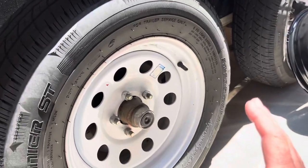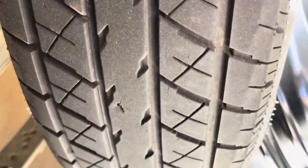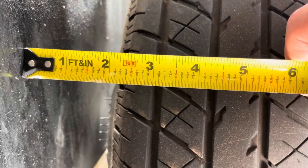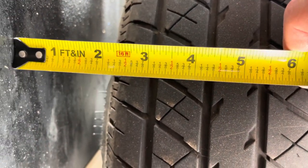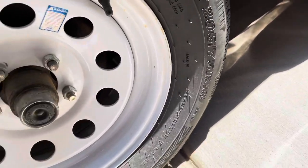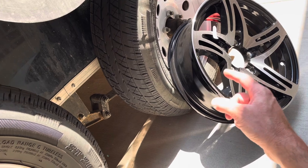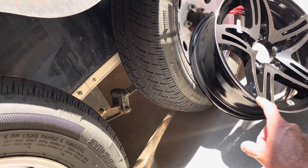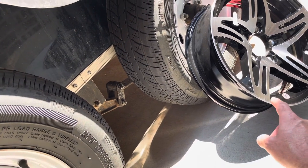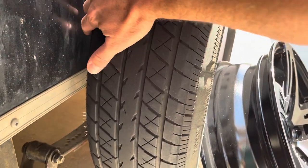These white steel wheels that come on this trailer are a five-lug pattern, five inches wide. From the inside, there's less than two inches of clearance to the side of the trailer. A lot of aftermarket aluminum wheels you can get for your trailer are six inches wide. This was probably the only one I found that was five inches wide, and the reason I went with it is just because of the clearance — I didn't want this poking out any closer to the trailer.